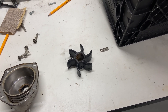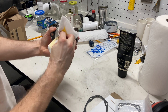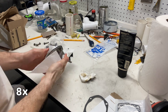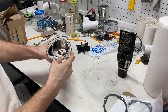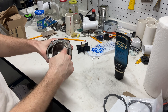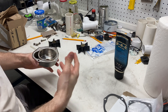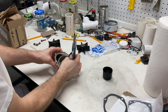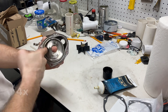If you're just watching this video to know how to replace the impeller, this is still the process to do it with. Now I'm just going to clean the cover because it's a little dirty — covering years and years, actually decades of gunk. I'm going to put a really thin film of marine grease just around the inside where the impeller contacts the case. That grease is going to get washed away in no time once I'm using the boat, but it'll help reassembly and that very first start-up.